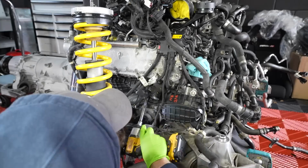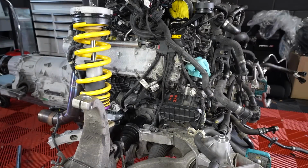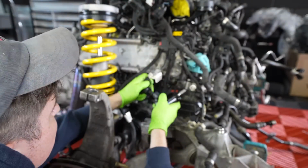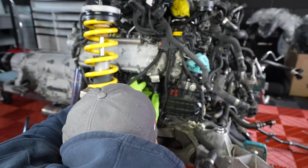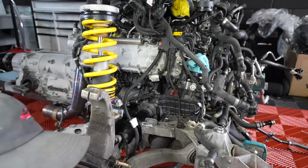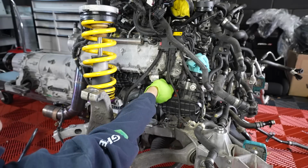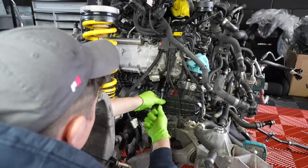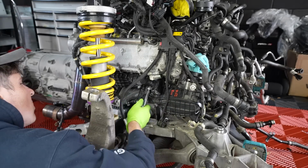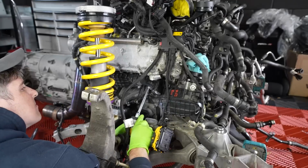By getting right into fixing this very complicated, weird motor that's attached to the engine. This is called the Valvetronic servo motor. What it does is allow the engine to adjust the valve timing on the fly by turning what looks like a little screw, moving stuff around in the engine. To remove it, you have to unbolt it and then spin the screw inside of it to pull it out of the engine. Reinstalling it is very similar. I think I did it right, but it's hard to find information online about replacing these. So to be honest, I'm not sure.